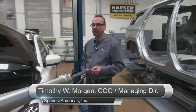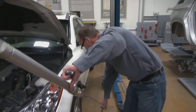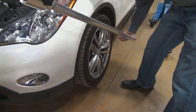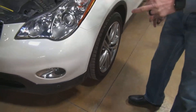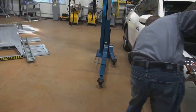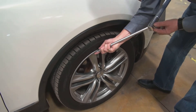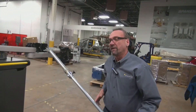Hi Touch users! Don't forget that using the mechanical items in your Touch software, you have the ability to do a quick camber check just by measuring three points on the floor and three points on the side of the wheel, and then comparing that to the undamaged side of the car. That quickly, I can have a camber diagnostics.